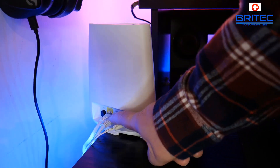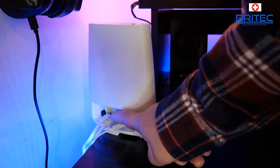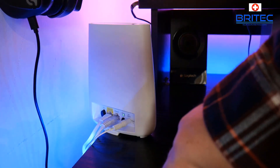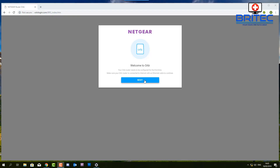If you want to use more ports you'll need to get a switch or hub, because the ports on the old Virgin Media unit will be obsolete. If you see a magenta light there's a problem — try to sync, reconnect, or go through the installation process again. It must be blue, and I'll show you how to get that blue.